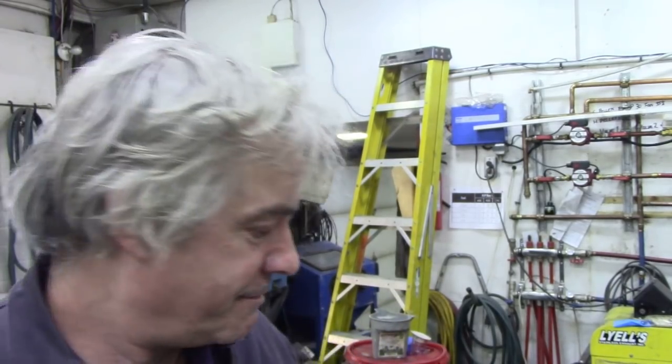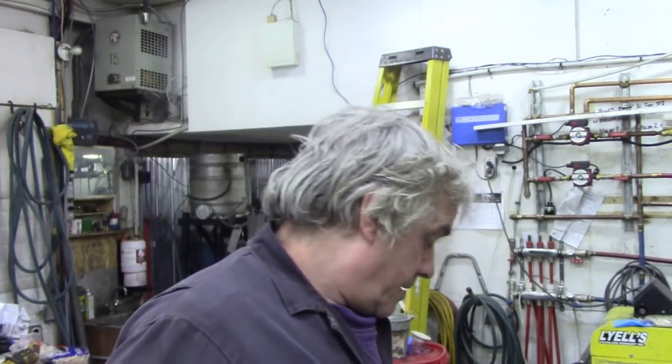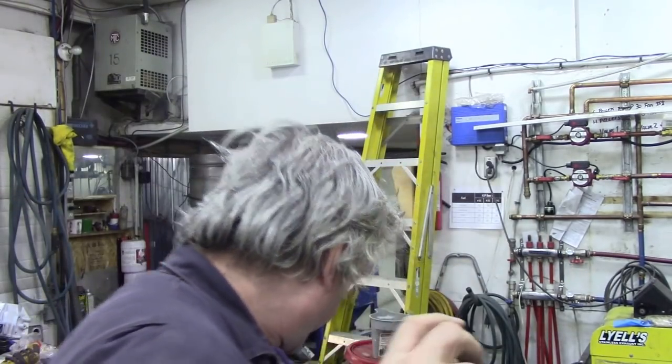So you had to keep taking it off and adjusting it to do the other side, if you see what I mean. You'd measure one bearing carrier and switch it to do the other side. Now, with a magnet, every time you move the damn thing, it would clonk and stick on there and shift all your settings. It's most frustrating. So that was one problem. So what did I do? Well, I put the pinion in and I did it like it says in the book. Don't put the sleeve in, set it up, put the tension onto it so the pinion doesn't move.